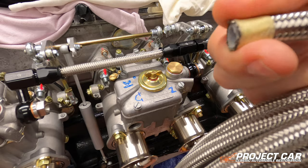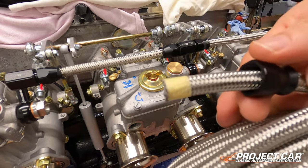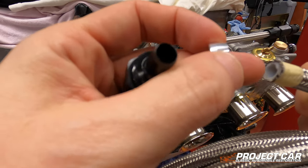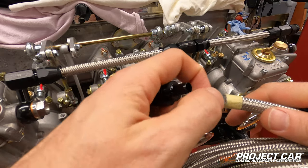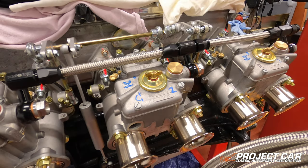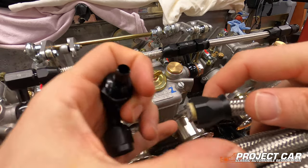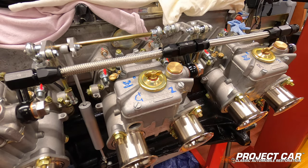So how does it work? I've got a loose part here. First you take the collar off — just be careful because there are parts inside. This bit slides onto your fuel hose; it's worth leaving the tape on until you've got the collar in place. That slides over it — easier said than done. Then you've got the main part: that silver ring goes eventually on the inside. You push the plastic tube inside, the metal part goes around it, and then you slide the whole assembly onto the little nipple on the black section.